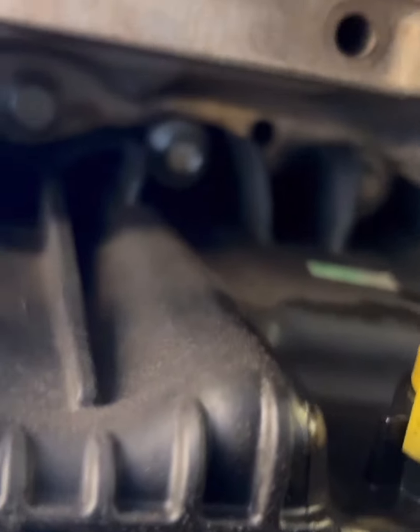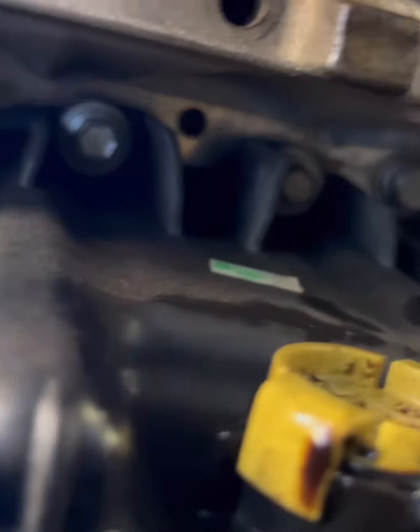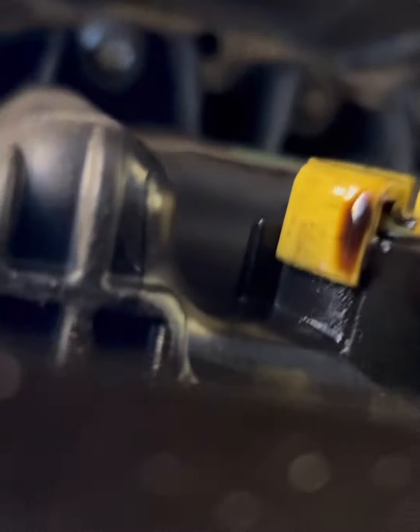Part of the shield will cover this particular part. To get under it there are four bolts — one here, one there, one back there, and another one on the opposite side. So it's a simple oil change on the F-150 2.7 liter EcoBoost.